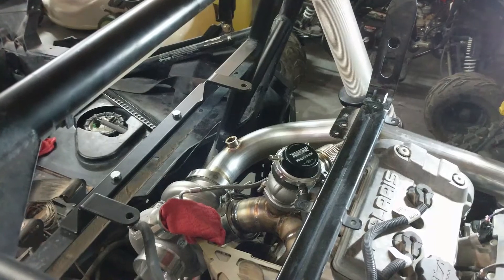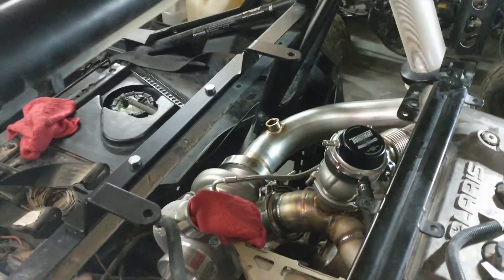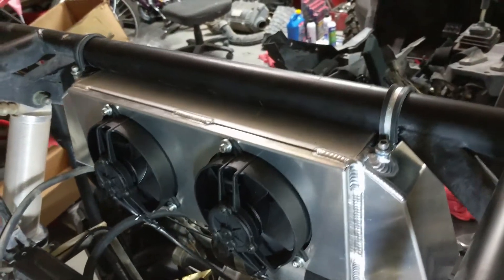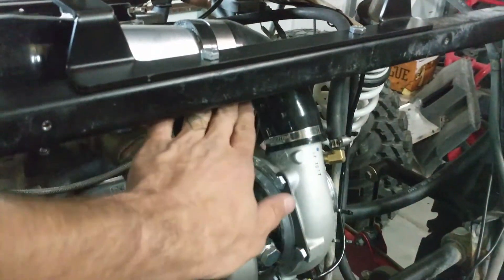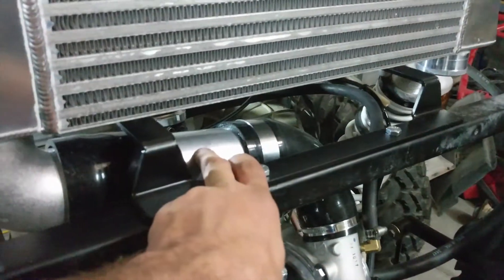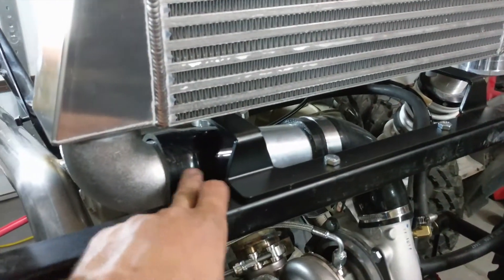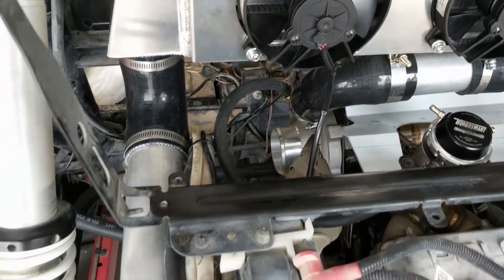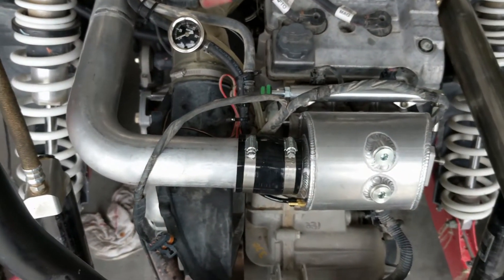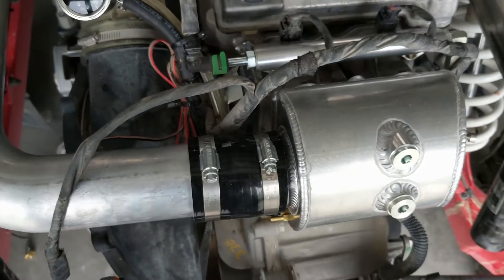When you're ready to go on with the intercooler, you mount this bracket here, and then there are two rubberized tube clamps that are going to mount up here as hangers. Once you've got your intercooler fully mounted, you can go ahead and run the two-inch up to two-and-a-half-inch coupler into the intercooler. The other side of your intercooler — that piece of pipe and another coupler.